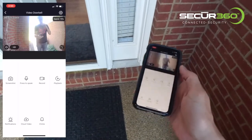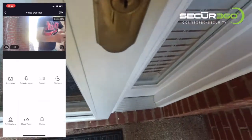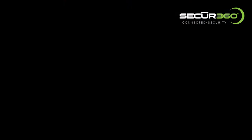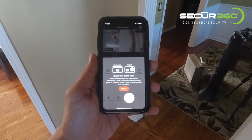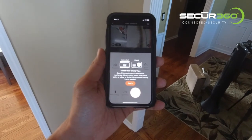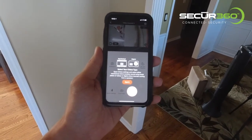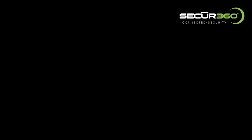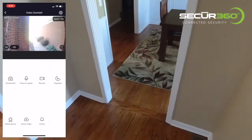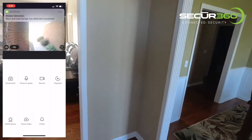The last thing you're going to have to do, depending on which chime you have, is select the appropriate chime. When you finish your credentialing, you will see this pop up. You need to select your chime type. Open up the chime settings and select either mechanical chime or digital chime. The mechanical chime creates sound using metal plates or tubes. The digital chime has a speaker that generates the sound. I have a mechanical chime, so I'm going to hit complete. Now when I press the doorbell button, my chime rings.